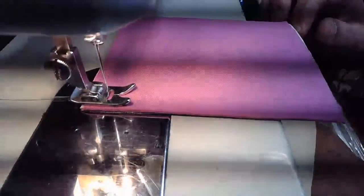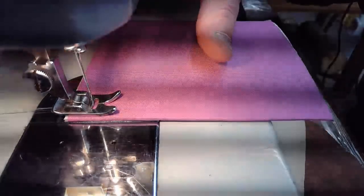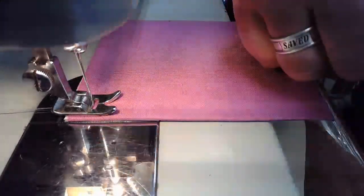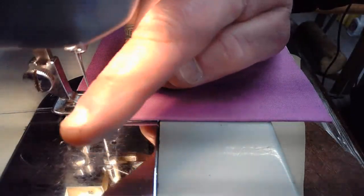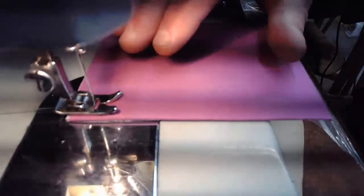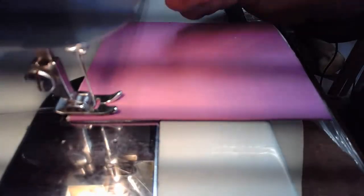And again, kind of like the machine that I just gave to Kathy Pecor as the grand prize winner of our calico contest, class 15 style machines that use that bobbin design, and particularly the oscillating ones, because like Paula pointed out brilliantly, when you're dealing with an oscillating hook, the range of motion it's moving is less. It doesn't travel as far going back and forth. And so the demand it puts on pulling that thread is a little bit more aggressive. So if you're sewing with a machine similar to this with an oscillating hook, once you get into your stitch flow, the stitching is gorgeous. And you're just going, it's beautiful.